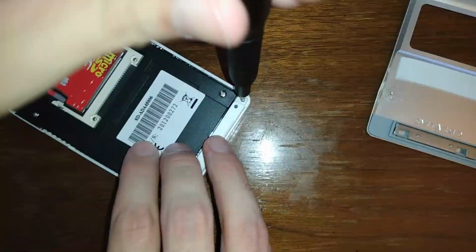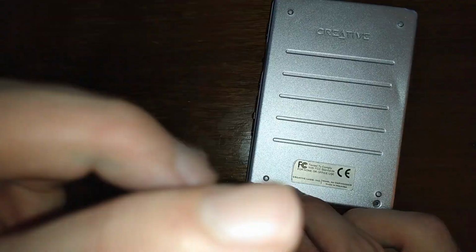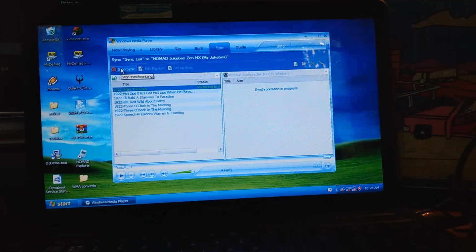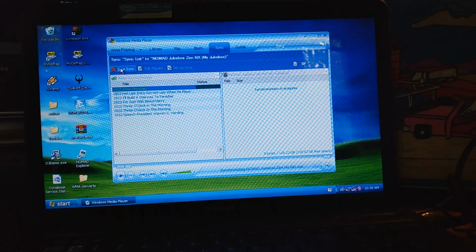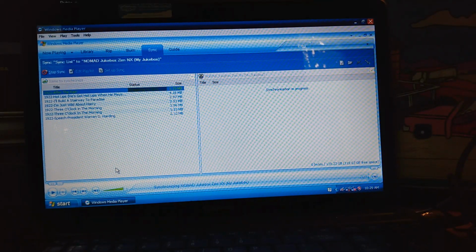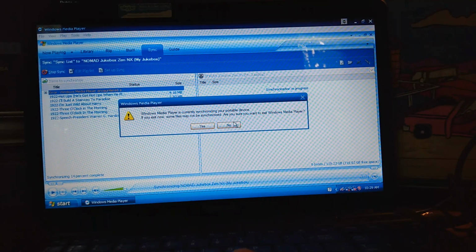Unfortunately, no mix of SD or compact flash worked properly. The player was able to recognize one specific combo, a 128GB microSD card in a compact flash adapter in bay 1 of a dual bay CF to IDE adapter. However, the adapters seem to throw off the USB controller, so the player is unable to talk with the computer.